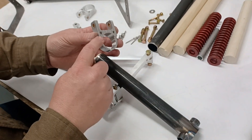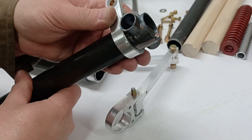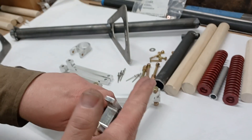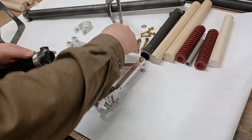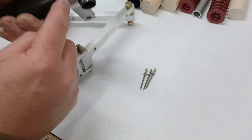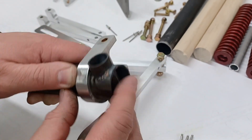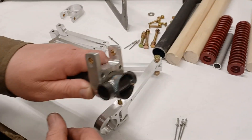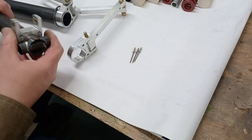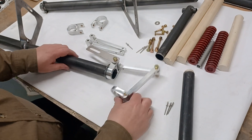This little notch — or key feature — allows you to put this on the bottom gear, and that key locks it from moving, holding it perpendicular to the axle. With your kit of parts, you'll use three stainless rivets spread out one, two, three around the perimeter while holding that down tight against the axle hole. That keeps it from moving around and holds it in position. The bottom pivot has bushings as I showed you earlier.